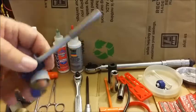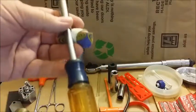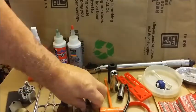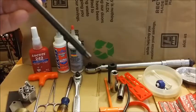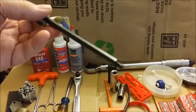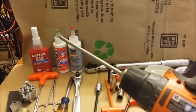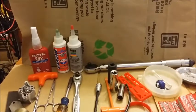You're going to need a T-handle — this is just something I happen to have — like an 8mm. You'll use that for putting on and taking off your carburetor. And this is a T27 — all the screws have T27 heads on them, so I got a 3/8-drive T27 and I have one on my drill. It's great for removing screws; you don't want to put a screw in with the drill because you could strip it out.